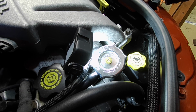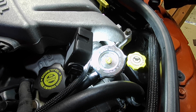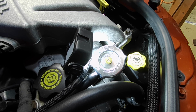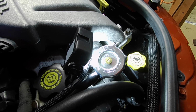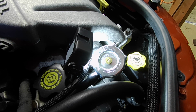It's a good idea to do this because your power steering system works under very high pressures, and if you get grit in there and stuff, it's really brutal on the system. It can't handle that. Same with transmissions, it's very similar. They both work on hydraulic pressure, and they're sensitive to foreign materials in the system. So it's a good idea to do this, I don't know, every 3 to 5 years, I guess. Most people never do it, so if you do it every 3 to 5 years, you're doing better than most.